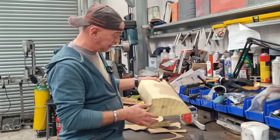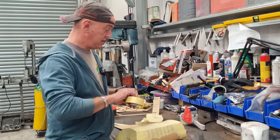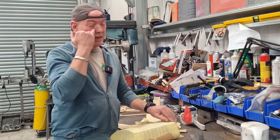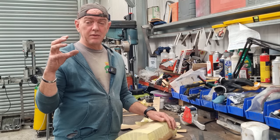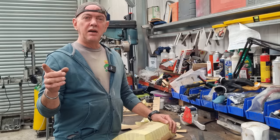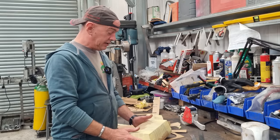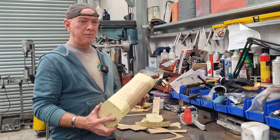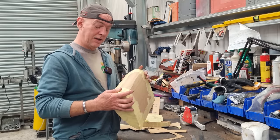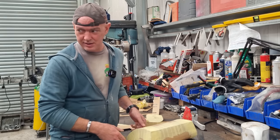Now, apparently the way to test this is to have a look at your oil pressure. Now, I haven't got an oil pressure test gauge. I have got one coming. Royal Mail's got that, along with my exhaust tubes that I'm still waiting on, so I'm not sure when it's going to get here. But apparently the way to tell is you stick the pressure test gauge into a test port on the engine. I've had a look in the manual, I know where it is and everything. And you take a reading. I think it's at 3,000 revs you have to take a reading. It should be 2.8. If it's less than that, then basically the bearing has shifted, it's passing too much oil, and it needs looking at. That, I think, is what's happened to the ZZR. But that fundamentally changes what I need to be doing next, in essence.